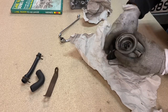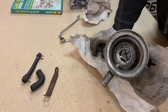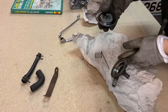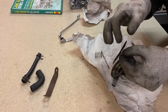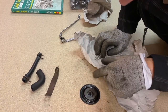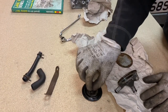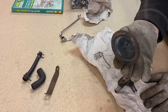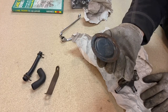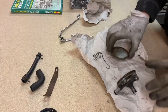Okay, got the spring out. That looks like it's just been taken off a running engine or working system because it's all oily in there. These are all the parts - so that's good. This is the diaphragm, which looks to be in all right condition. I know they usually say to replace them but it looks like it works - there's oil on the inside and nothing where it pushes against the ring. I'll clean the diaphragm with warm soapy water and clean the rest with brake cleaner.